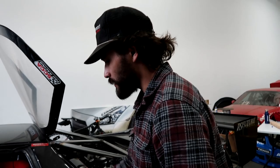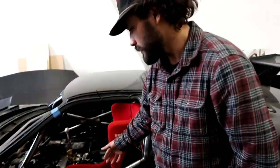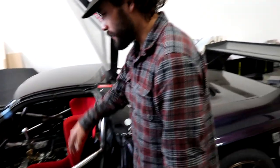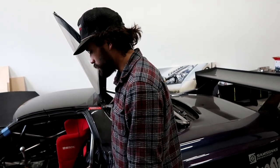We're going to start off with my favorite part of the cage, which is the door bars and FIA bars. The gussets in there and how everything looks came out really well — it's exactly what I had hoped for. So I'll let Riley explain what's there and why. The taco gussets were probably on in the last video, maybe the FIA gussets. The taco plates are welded all the way around — they're one piece, with just one seam on the back. The taco gussets on the FIA bars and the upper door bar are all finish welded in. Welding some thin sheet metal to the tubing was a little bit of a challenge, but we got it handled.